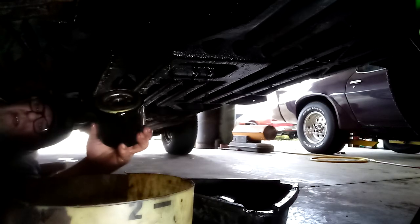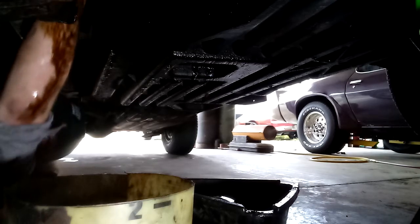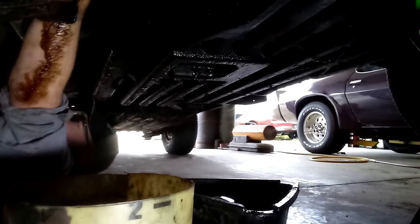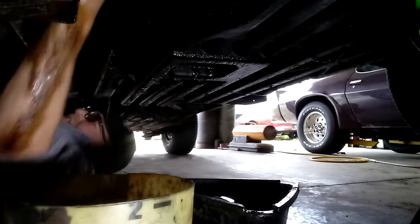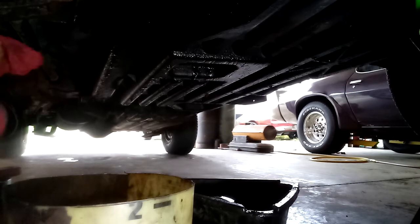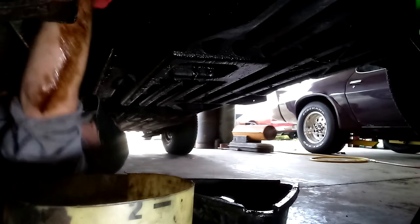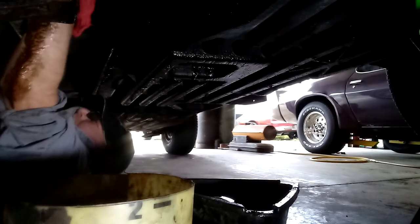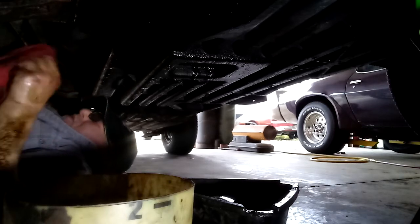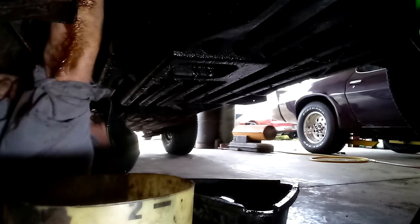As you can tell, I do fill the oil filter up full of oil as much as possible, a couple, 3 times. You don't want to cross thread this either. It's kind of hard with your hands all oily and slippery once you get her started. Wipe the oil filter off. Get all the excess oil off there. Yeah, MicroGuard from O'Reilly's is a pretty good oil filter. If you cut them apart and watch the results on the YouTube channels, Fram is one of the worst. So you get the oil filter all wiped off.